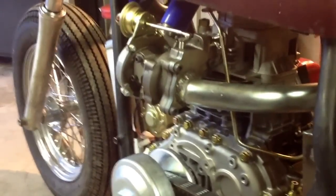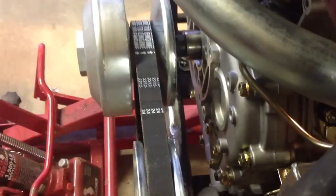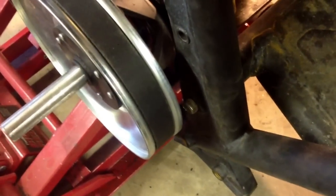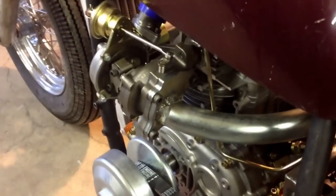One of the only downsides I'd see to this so far is that the CVT is spaced out a little far from the motor — it's not up flush like I wanted it to be. That's mostly because I couldn't fit it all in the frame for the driven pulley; it would have clearance issues, so I had to bring everything out as far as I could while still trying to keep the motor towards the center of the frame.